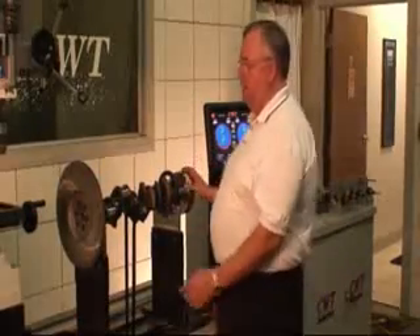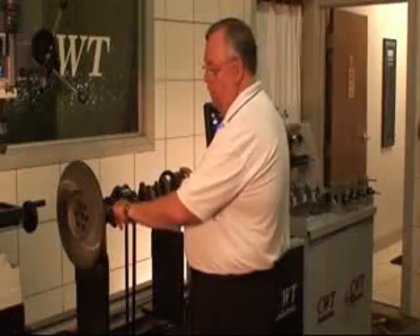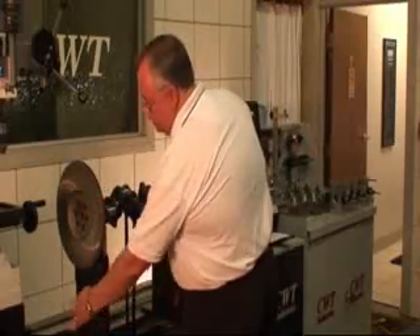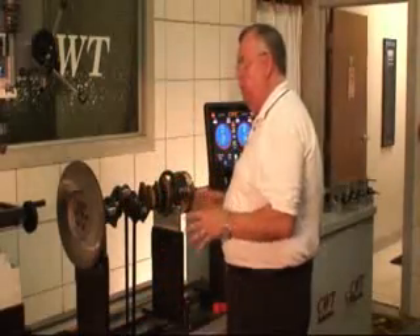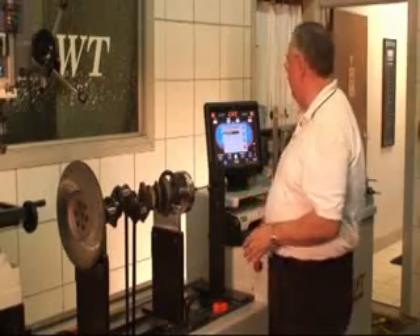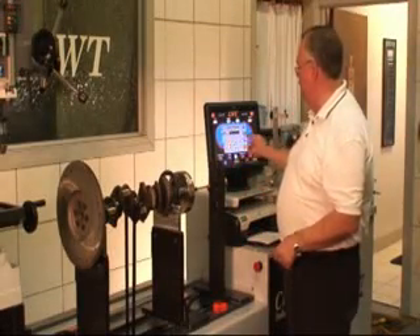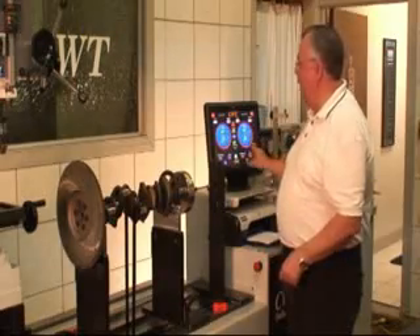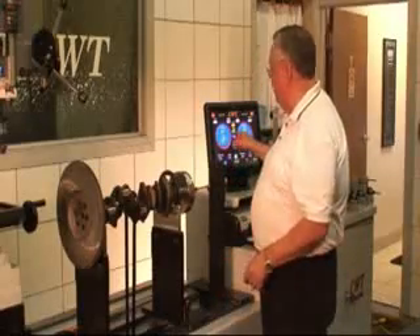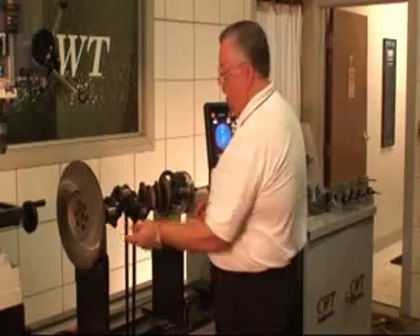Alright, when we first mount the crankshaft up, the only thing we really have to do is ensure that the oil hole will straddle the glide blocks. So we just position that — you can move these stanchions left or right. We already have a memory for this program, so if I just go down here and call up 3024 and hit load, it will automatically put the setup numbers in there. I can look and it's 19.25 inches for the bearing spread. I can just come over here and, voila, there we are.